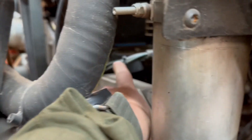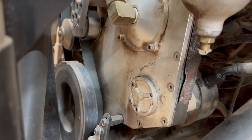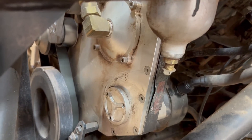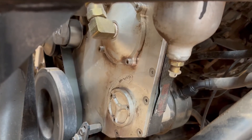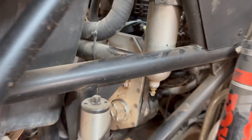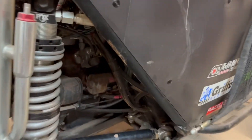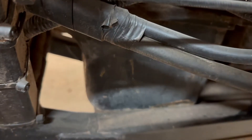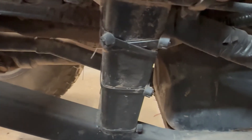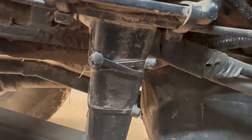I'll mount my power steering pump up here — I'm getting one that's going to be belt driven, and I'll be able to overdrive it a little bit too. The Cummins isn't going to have the RPM swing like a gasser would, so instead of going from 800 to 8,000 RPM, this thing's going to be running from 800 to about 3,200. It's got a 4K governor spring kit so it's supposed to rev out to 4,000, but realistically it really maxes out around 3,200. I'll also have to build a custom oil pan because my oil pan is as low as I can get it. I'm going to try a center sump — I'll make it shallower and put baffles and trap doors in it so it can gather all the oil and keep it in there. I also have an Accu-Sump on this, which helps a little bit, but I want to do my best to keep it from needing it.